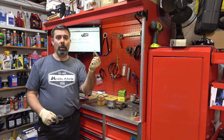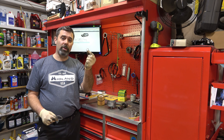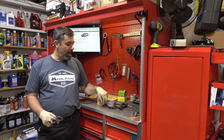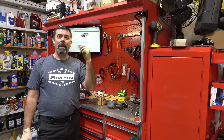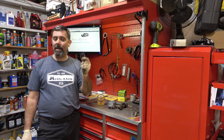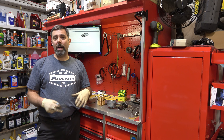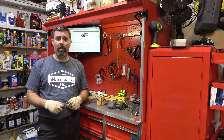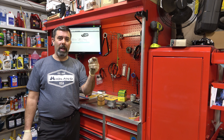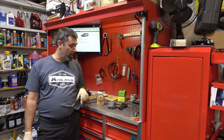This right here is our aluminum drain washer. When we take our drain plug out, there's a crush washer behind it — that's this. You can get away with reusing them once or twice, but that's not a great idea. Lastly, if it's been more than maybe 10,000 miles, this is our oil cap gasket. A lot of times oil leaks get misdiagnosed as being bad flame trap boxes or hoses or even rocker box leaks, when it's just as simple as a $2 washer or $2 O-ring.